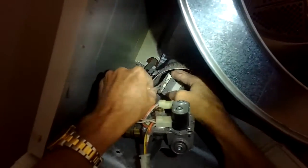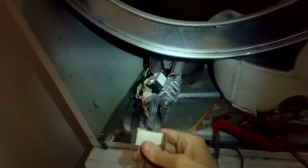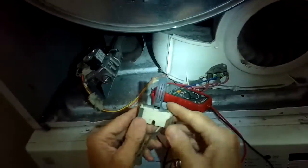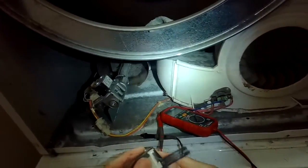I'm going to use my fingers to push it off the spring clip that's holding it on. Sometimes you have to remove a little screw that's holding it on, but this model is just a spring clip. The igniter doesn't look too bad — I can't see an obvious break — but I can tell from the meter that it is broken.